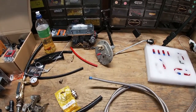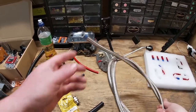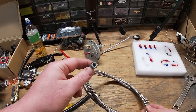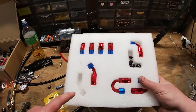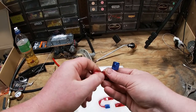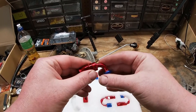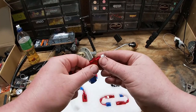Last video I was talking about what I was going to use for my fuel lines. I went ahead and used what is called PTFE, or just Teflon — there's a Teflon core and then a stainless steel braided outside. From what I understand, this is impervious to gasoline, oils, ethanol, E85, high octane fuels like 91 and 93. I also bought the 10-piece fittings. These are dash-6 AN style fittings, but that is not the same as the typical ones you see where they use rubber fuel line — rubber fuel line will not work with this. Make sure you have the proper fittings if you decide to use the Teflon fuel line.